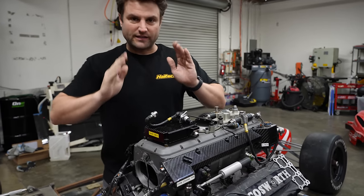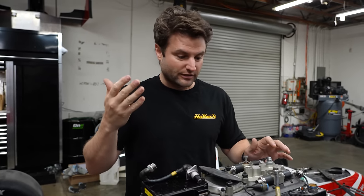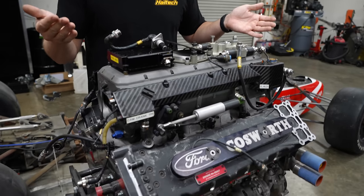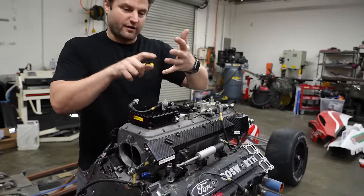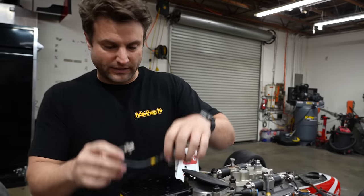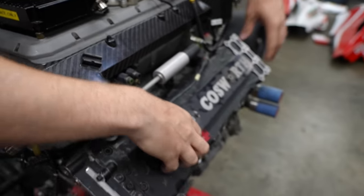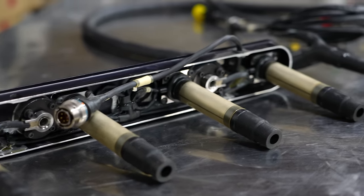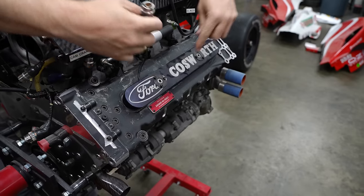Focus on the most specific, most critical thing. Then if you're looking for a dopamine hit, find something familiar. Even in my position, there's nothing on this motor I've ever used before. So how do you take the next step? Work backwards from air, fuel, spark. I looked at this box, and even simpler, it starts down here. I was looking for spark, and sure enough, there are the coils — COP, coil on plugs.